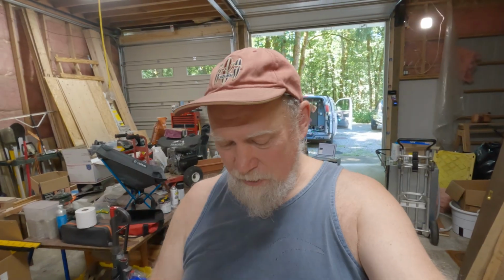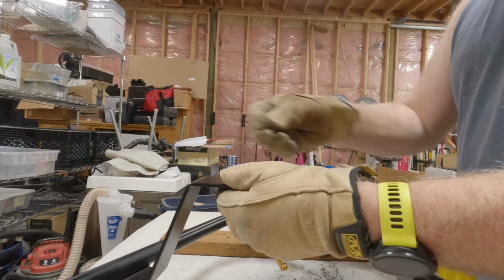But wait, before I forget, there's one important step before you put that bracket on the van. It's to put the carrier bolts that are going to hold your tire on first. They have these little metal clips, and from what I've read online, it's kind of a pain in the ass to do once it's on your van. So, while you've got it flat on a table, put those bolts on.